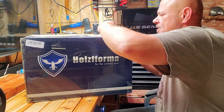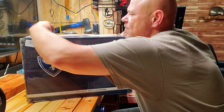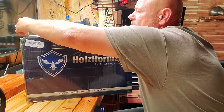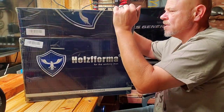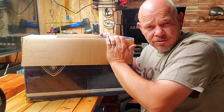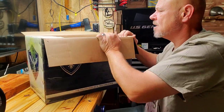Tomorrow we're gonna have the 372, 65CC version, which is the 48 millimeter piston, and I've ordered a big bore kit for it. We're gonna turn it straight into - what is that - 78CC? Good times!